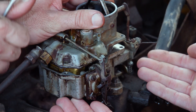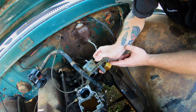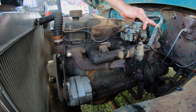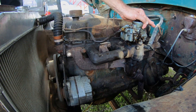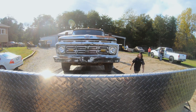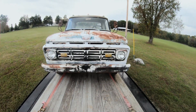Our last recourse is to take apart the carburetor right there in the field. We found the float spring was jammed, so we sprayed a lot of Sea Foam Deep Creep into the springs. Don't let that spring go — bye-bye. The last thing we want is to drop one of those small springs or screws. We cleaned out the old gas in the bowl and put the 57-year-old carb back together on the engine. That's the sound of success. It seems we do have a vacuum leak, so placing your hand over the intake acts as a restrictor to keep the engine running. We had to be careful to drive the truck onto our hauler because with the engine leak and no brakes whatsoever, this is trickier than it looks.